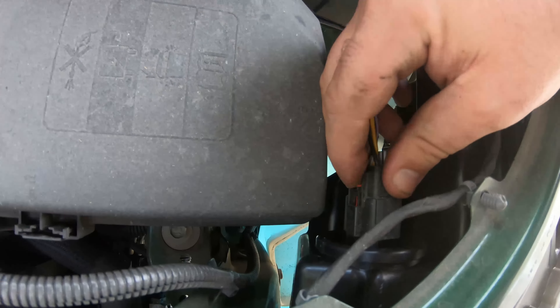This is actually a 7 mil, not a 10 mil on the side here. GM pretty much only uses two bolt sizes on these kinds of things — headlights, fenders, bumper covers — it's 7 millimeters and 10 millimeters. I thought that looked a little larger so I went with the 10, but it was actually a 7. We're gonna turn the headlights on now and see if they work. Headlight one, headlight two — hell yeah, we've got headlights!